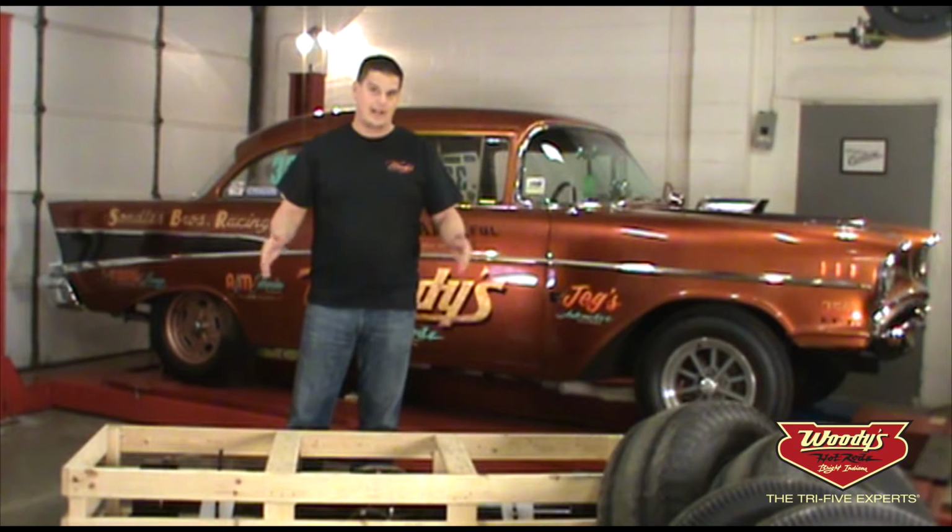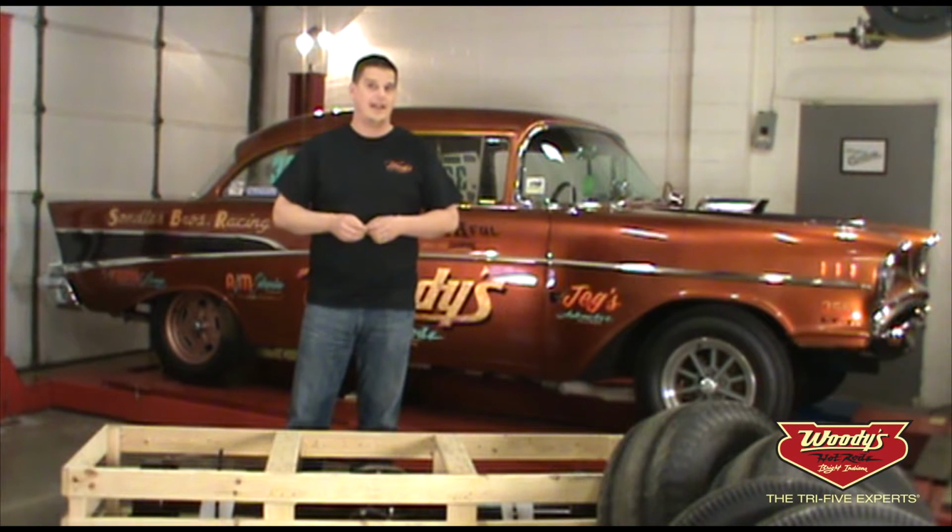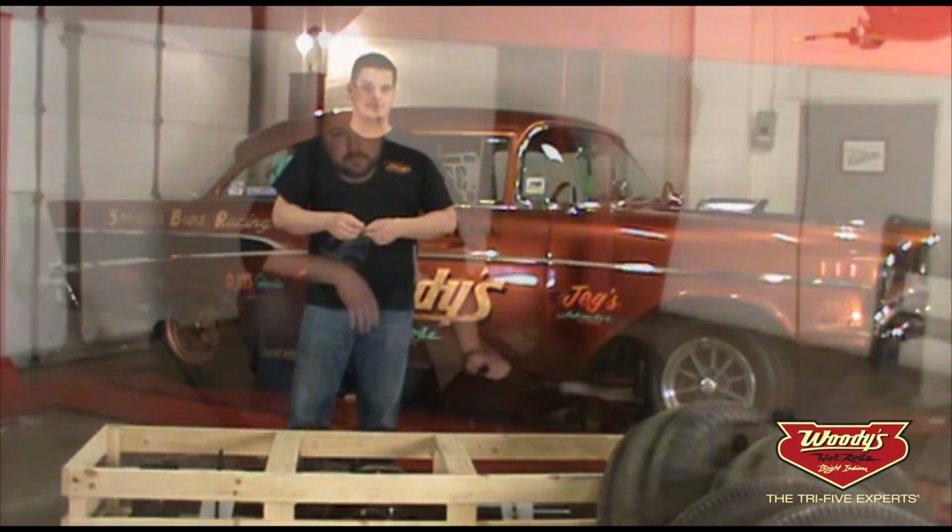We opted for a stock width 60-inch rear end, but with the spring perches in the narrowed location, which means we're going to have to inboard the leaf springs. In order to do that, we're going to use a Performance Online inboard kit that's available through Woody's Hot Rods, a new set of leaf springs from Dan Chuck, and to top it all off, a new set of Cragar SS's from Cragar wrapped in some new Firestone rubber from Coker Tire. It'll be a fun one.